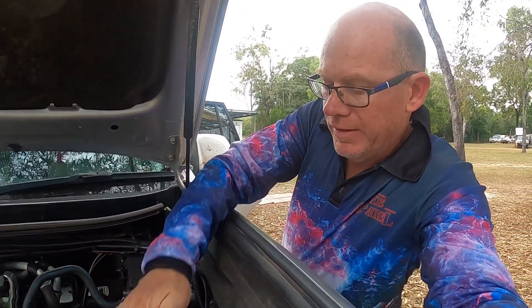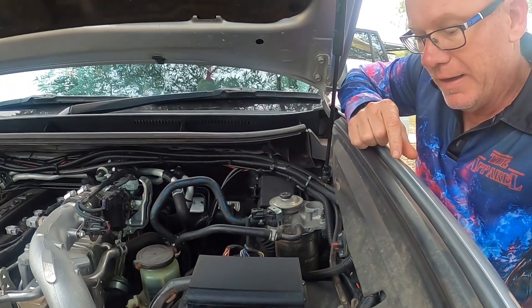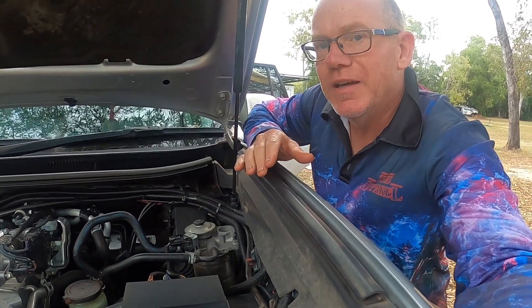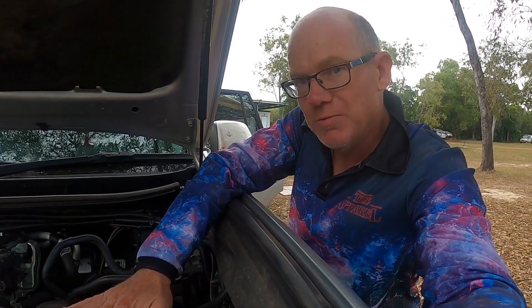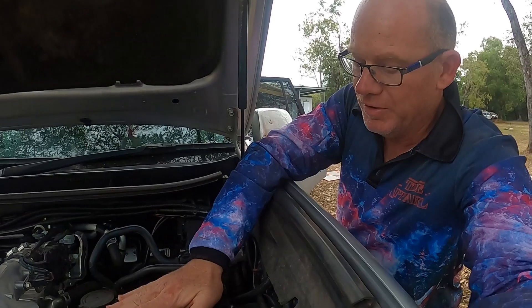So why the Redarc? From my previous videos you would have seen my trip to Cape York — I had a different brand installed and went for a cheaper option. We got a red rider DC-DC battery charger, bought it super cheap. I've had it for a while but never done an extended long trip like that one using it. It's a 30 amp, which I was happy with, but it gets very hot — even when solar is running through it. At some point you can't even put your hand on top because it's so hot.